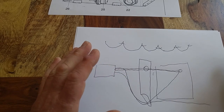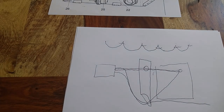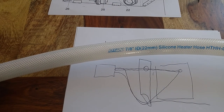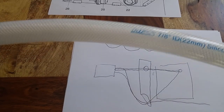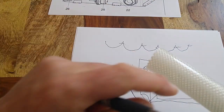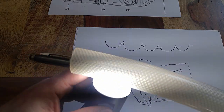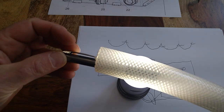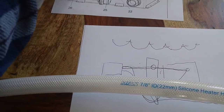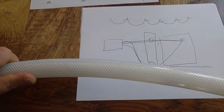But while I was at it, I was thinking it would be nice to know if I make this repair whether I actually get rid of the air bubbles. Well, here's my super secret weapon. This is 7/8-inch inside diameter — which is 22 millimeters — silicone heater hose. The nice feature about this is it's clear. It's got reinforcement going every way, but you can see it's clear. With a flashlight behind it, I'll actually be able to see if I've got air bubbles in there or not. Get the automatic air bleed mounted like it should be, and get rid of this big loop and put a section of clear silicone hose in here.